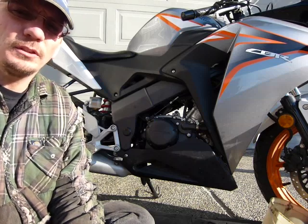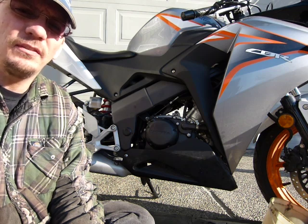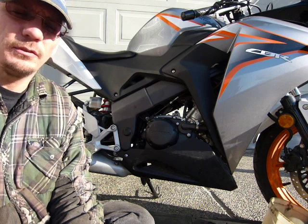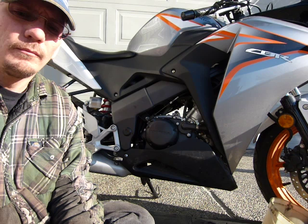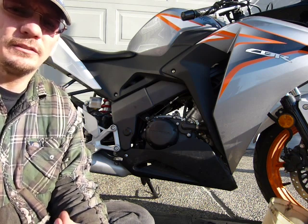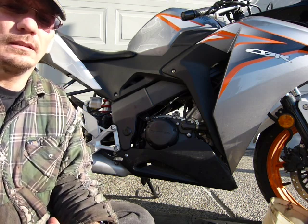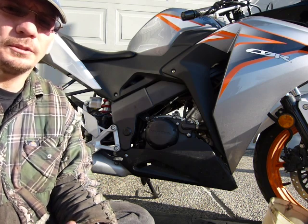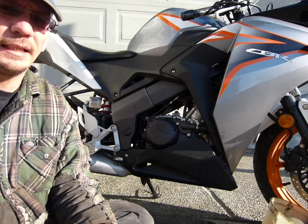I am about to do the first oil change on this 2011 Honda CBR125R. The first oil change is extremely important that it be done on time, because it removes the contaminants from the engine oil, suspended metal particles that are generated in the breaking-in process. I'm going to show you in this video what you need for the oil change and how to get it done with the least amount of mess.